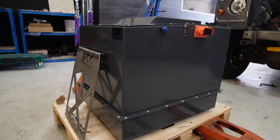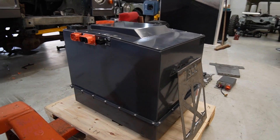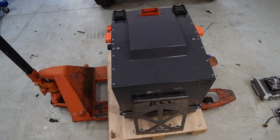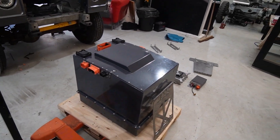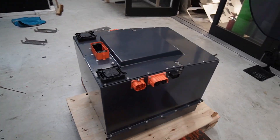We've got here a 55 kilowatt-hour battery box which is actually made by a company called Felton, who supply us with battery gear and BMS's etc. That box is sort of prefabbed and we ultimately have to mount it in the car, mount a couple of other bits, and do some extra wiring to it, but a lot of the work is done in there.